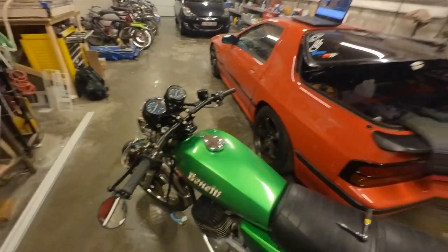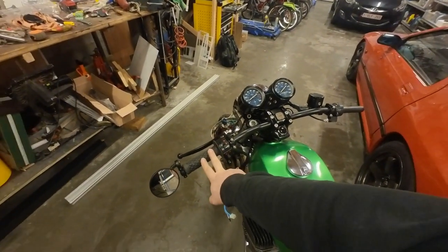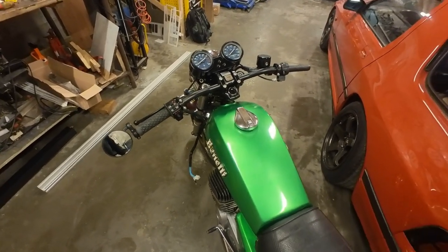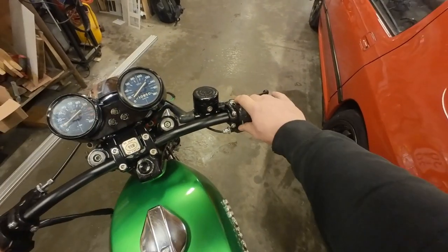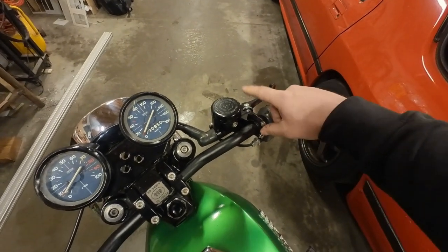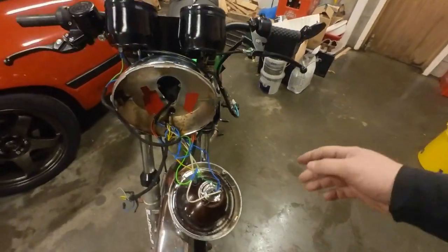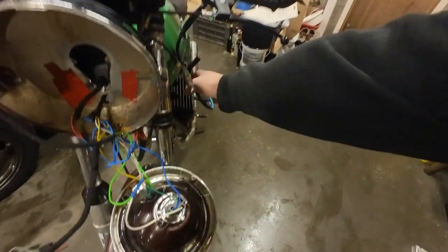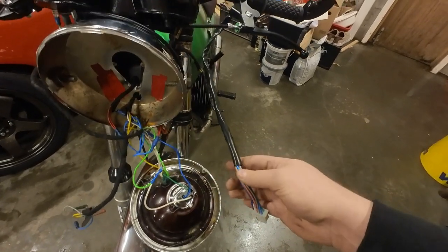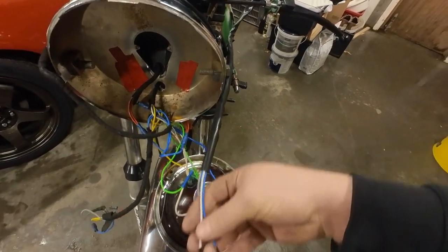Flash forward a couple of days when the throttle arrives. I just wanted to give a small update because my camera died. Nothing super weird happened — I've installed the left side grips and the handlebar mirrors. I think they look pretty cool, it's a sleek look. I'm still waiting for the throttle. I've just positioned the right side to check cables with the longer handlebars, and I've also quickly mounted up the brake lever — I still need to fill up oil and bleed it. I've also opened up the front headlight to pull back some wiring so I can include the new switch. I'll just cut the old connector off, put pins on each wire, and measure them to know which is which. Blue and white might be power and ground, but we'll see.